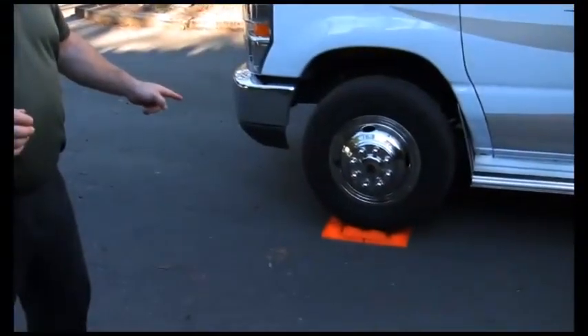First thing you're going to do when you pull into the campsite is get your RV totally level, or at least level enough. You'll notice here I'm up on some RV Lego bricks — these orange blocks, they stack up like Legos. The front end of the coach was too far down, so we ran it up on some blocks at the emergency brake. You want to make sure that if you were an egg in a frying pan, you're somewhere toward the center of the pan and not off on the corner. Front to back is more important for the refrigerator; side to side is just for your comfort.